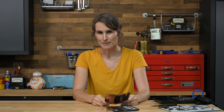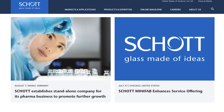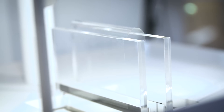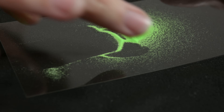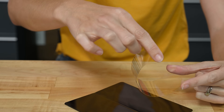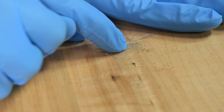One of the key technologies making folding phones possible is ultra-thin glass, and this glass is only made by two companies in the entire world. One of them, Schott AG, sent us a sample so we can see exactly how this works. The Fold's glass is thinner than a strand of human hair — so thin you can bend it with a one-millimeter radius. But there are limits: anything under glass this thin will cause severe Princess and the Pea discomfort, slowly reducing that bend radius. And grit like sand can be sharp enough to scratch glass, leaving it even more fragile.